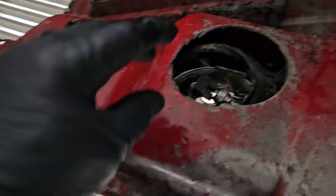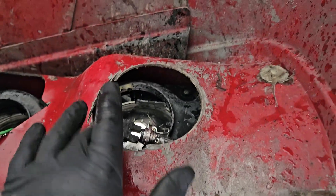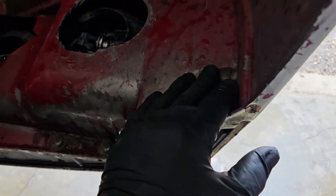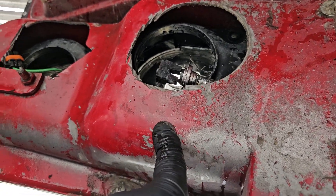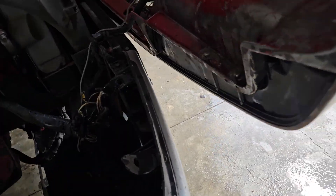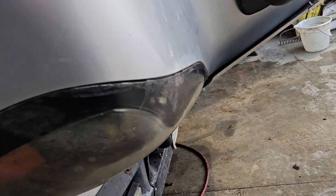So what I did was I took a pump sprayer — if you don't know what a pump sprayer is, you can look it up — and I took the lights out on the back. Because on this truck, for these aftermarkets, you had to drop the whole entire light to change the bulb. So I put a four-inch hole saw on both sides and drilled out. Then I siliconed the lights in place because they were getting beat up and wanting to come out of the secure mounts. I took Dawn liquid soap with about a gallon of water in a pump sprayer and I sprayed all four holes on both lights. I filled it up and then I took an air tool and put it inside, and it created like a little whirlpool in there to kind of scrub everything.